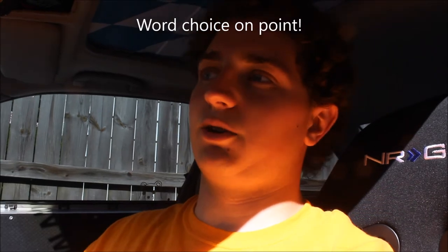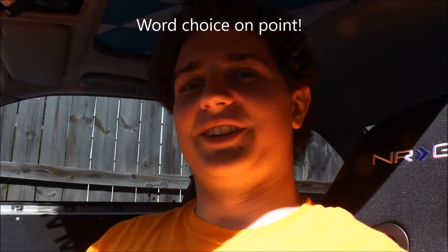Definitely a shorter video today — I do apologize. Just to kind of sum up what we did: pretty much took off all — I believe there's 34 little nuts on the back of the wheel — hammer them through with a little punch and a hammer. Make sure you put them all in a big bucket because at the end of this whole process we're going to soak all the nuts and bolts in vinegar to get all the corrosion off. We then separated the faceplate and the lip, or the barrel I guess you could say. I'd like to have had the whole day to work on this paint, but it's already 5:30, so we're definitely not going to have time to do that today. This process took a lot longer than the video kind of showed. Thanks for watching — come back if you'd like to see the painting process and the finished production of this whole wheel assembly process. It's definitely time consuming. Thanks for watching, and I'll see you next time.